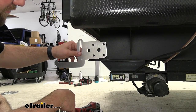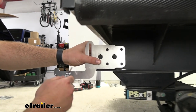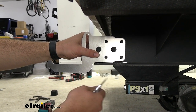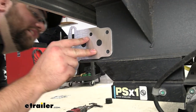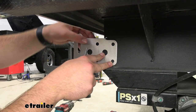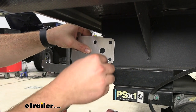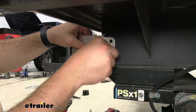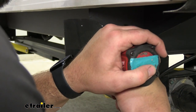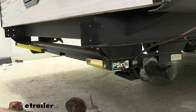With our paint all dried up, we'll take one of our brackets, hold it up, and make sure the end of it here is level. We're going to be lining it up — we do have a bolt that sticks out on the other side, so make sure you're not going to be hitting that when you put your bracket on. Line this up, and we're going to take a punch and punch out the center of each of these holes. Then we'll take a pilot drill bit and drill out our four holes, eventually stepping up to a 25/64 drill bit.